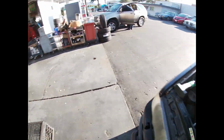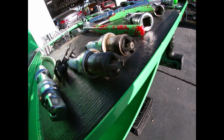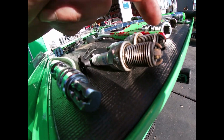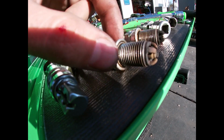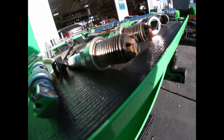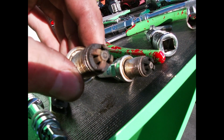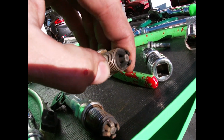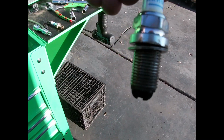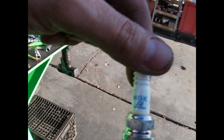So yeah, pulled the coils out obviously, but I pulled the bad plug out, and then I pulled the regular plug out to compare to. Here's the good one, supposedly, cylinder 1, and here's cylinder 6. But the electrode's like gone. Center electrodes are flat. And guess what? No way. No good Kevin's ruining coils. I'm shocked.